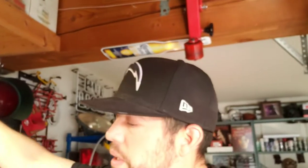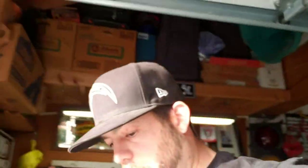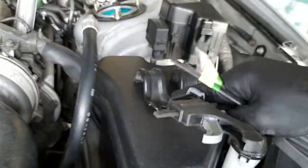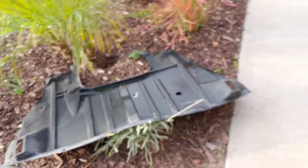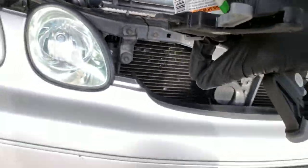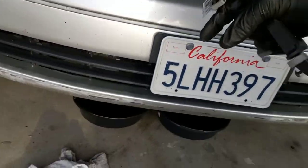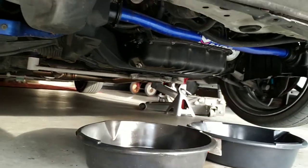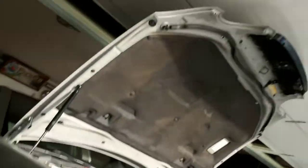I can't really video a whole bunch, but I'm going to use vice grips to clamp those transmission hoses and disconnect them. What I did was I took off these two brackets — these 12s right here — and took off the shroud. All the big screws go in the very front because there's a thicker piece of plastic to go through. There are also a couple of plugs I'm going to disconnect.